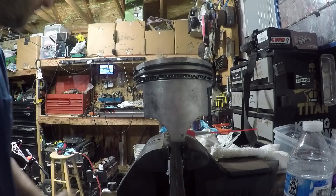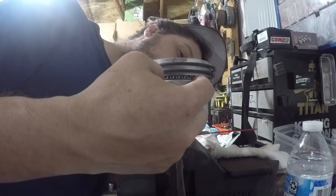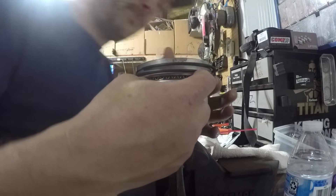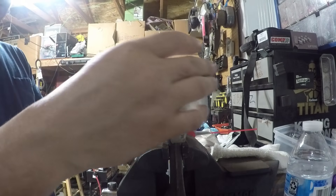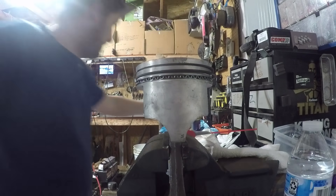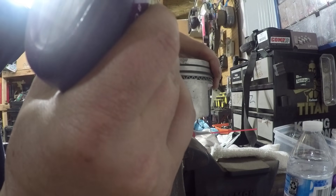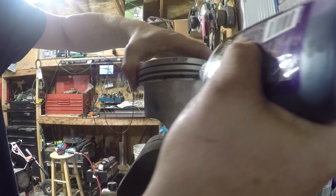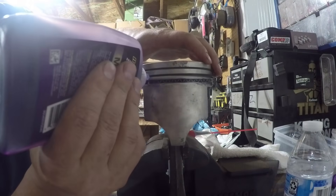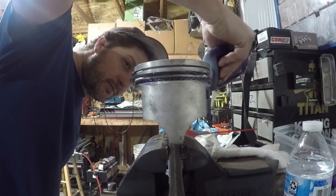Compression rings are in. I've got the oil ring clocked here, clocked on the other side. Got the split in the back right above the rod. Two compression rings there and there, so we are clocked where I want to be. I'm going to go ahead and apply my Royal Purple assembly lube. I could have screwed this whole ring job up with this synthetic lube — we'll discuss that.